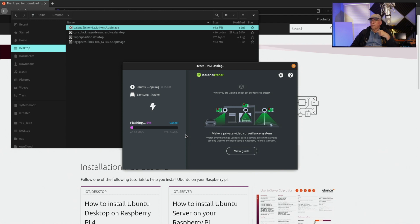Now, I had previously set up the Pi to boot from a USB device, so you might want to review the instructions. They're on the Raspberry Pi Foundation website. It actually does have a BIOS, and if you've updated the firmware on your Raspberry Pi 4, you should be able to use the USB boot process. I have already done that, so there's nothing I need to do other than plug it in. But if you have a Raspberry Pi 4 with 4 gig or more that you've had for a while, you may want to check to see if you need to update your BIOS on the Raspberry Pi. You'll have to have Raspbian up to do that. Sorry about that, but that's the way it works. You would do an rpi-update for the firmware, I think it is. But there are instructions on the website you can follow to do that. I'm not going to go through that today. I'm just going to stick this on here as soon as it's done. I'll be back. This is going to take a bit.